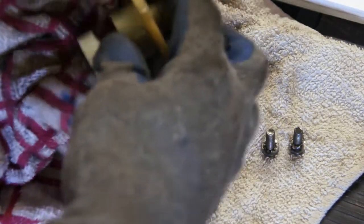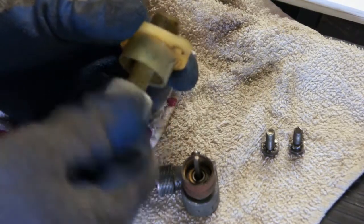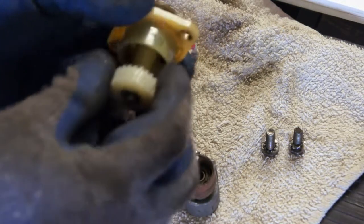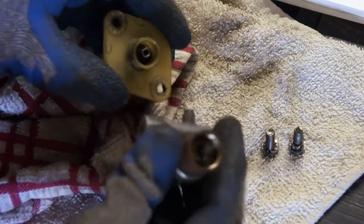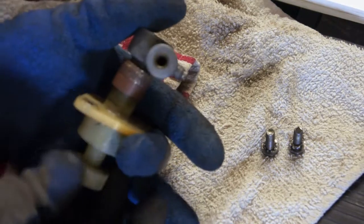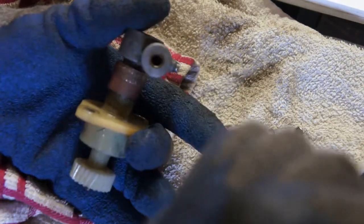And so obviously the gear in the gearbox that meets up with this is just some type of plastic gearing, and it spins the square tubing there, and that mates up here, spins this, and there's some type of reduction or gearing to make it spin at the proper rate inside there, and then this spins, and that attaches to the cable that goes up to the speedometer.